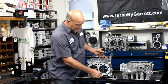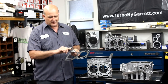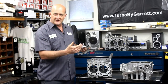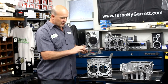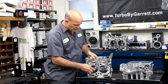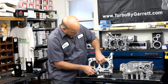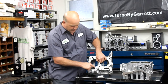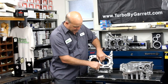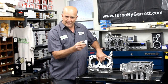What we did was some math — we took half of a thermostat housing, which would be the water flow going through one half of the block. The other half would clearly be used for the other half. We took the total square inches of this surface area and looked at the water passages going through. Some questions arise when the gasket is on top of the closed deck block and some ports appear slightly blocked off. We found that the total surface area of the lower half of the block exceeds half of that thermostat housing.